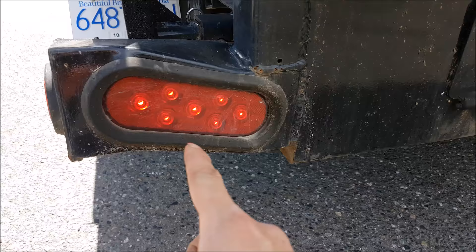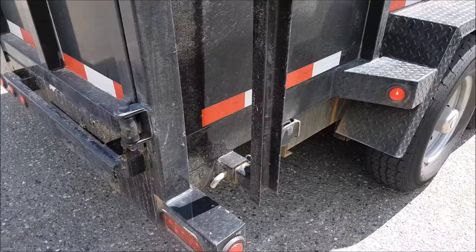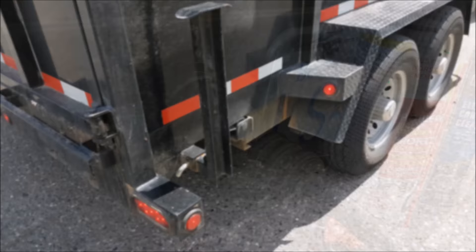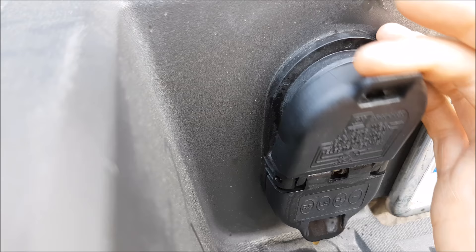Now we can do our 360 check. We have our marker lights on — that's all working. We'll check reverse later. This one, the marker light is working but the signal portion isn't — it's been damaged, you can see it's kinked. This one is straight, which is what it's supposed to look like, so that kinked one needs attention. After checking everything, we just have a few more checks with the brakes. The biggest difference we noticed is that after spreading those pins, the plug doesn't move around nearly as much as before — before it felt really loose, but spreading the pins helped quite a bit.